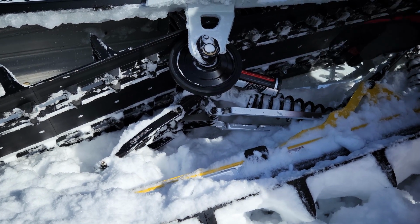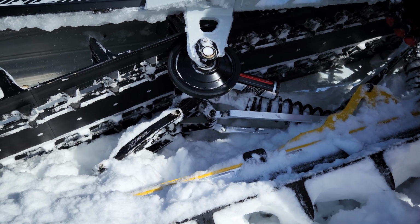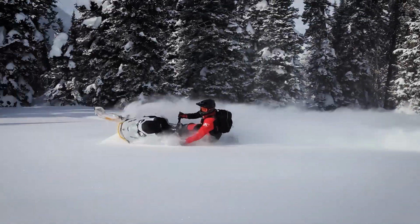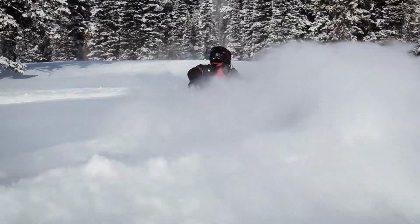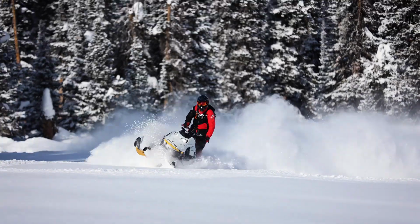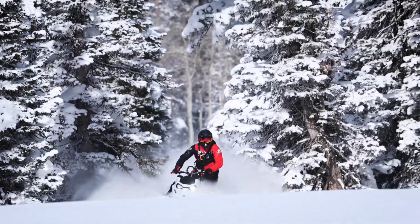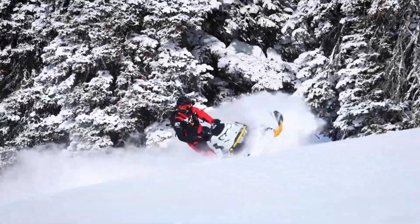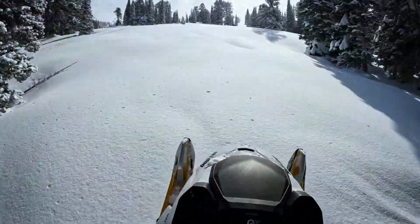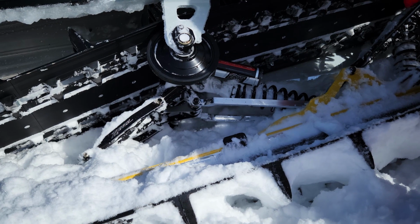And to do that, we provide the shock absorber, which is tuned, and we have a couple of different options. We have a standard and aggressive. I've been riding the standard on this prototype, and I love the standard myself. I'm about 200 pounds, so probably 215 or 220 with gear, and the standard works really good. So unless you're over 220 and really aggressive, you're probably not going to want the aggressive setup. But if you are going for big sends and you really need that extra rate and dampening change, go with the aggressive setup. Otherwise, stick with the standard.